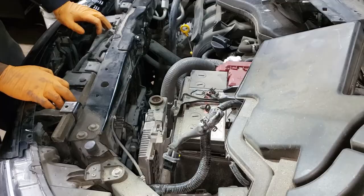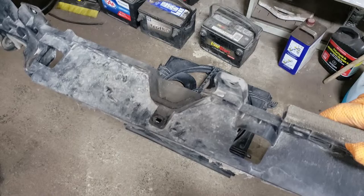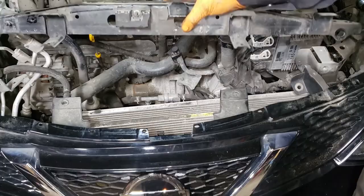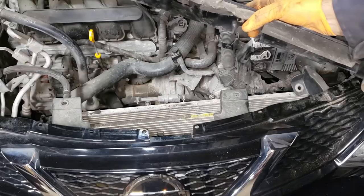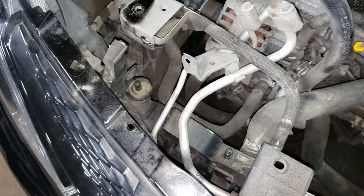There's the old fan, and it's pretty easy to get out — like a five-minute job once you get all the other crap out. Essentially I tried to release the metal piece just enough to sneak the fan out, and of course that wasn't enough. So I ended up disconnecting the battery, because I then knew I would have to disconnect my airbag sensor. Then I proceeded to disassemble this section because there was a 10-millimeter bolt holding the air conditioning lines.